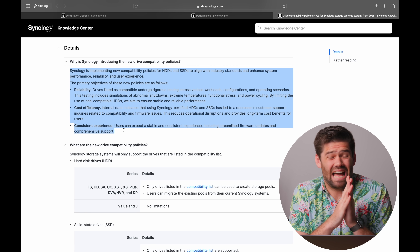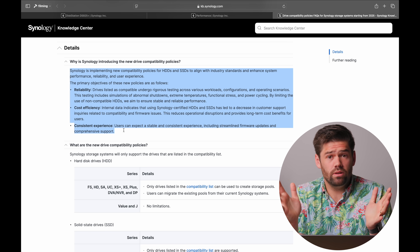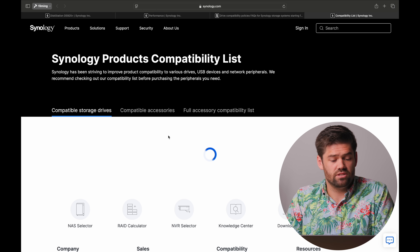Those incidents were fairly isolated — I've seen it happen very rarely, only with really cheap drives, and there was one or two batches of bad IronWolf firmware about six years ago that genuinely caused issues, where certain Synologies would grind to a halt. That was the only time I've ever seen that, other than people buying SMR drives and wondering why they're running super slow. It would be reasonable for a company with a large, actively tested compatibility list to ensure drives are guaranteed to a certain extent — if there were actual issues, which there were a few.